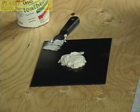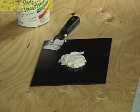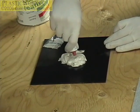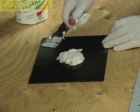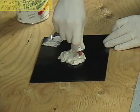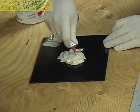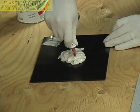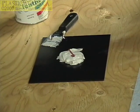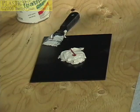Auto body people really like that, and basically this is auto body filler. What I always tell people to do is you put a stripe on top. The longer the stripe, the faster it's going to set. Now, I want this to set reasonably fast, but if I put a full stripe, it'd set really fast and probably faster than I can work with it.